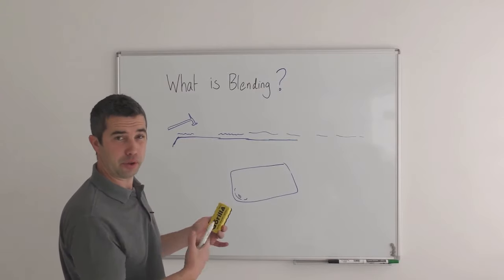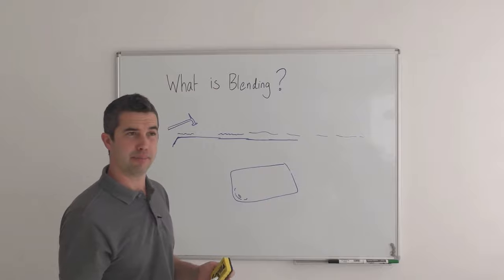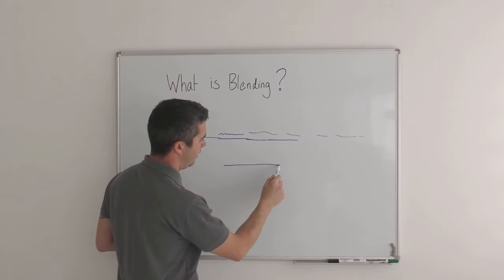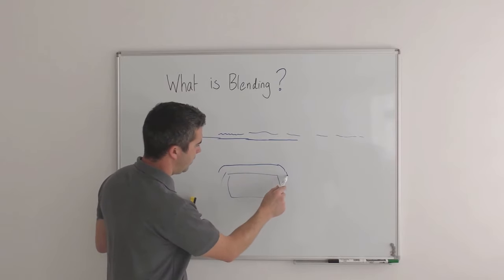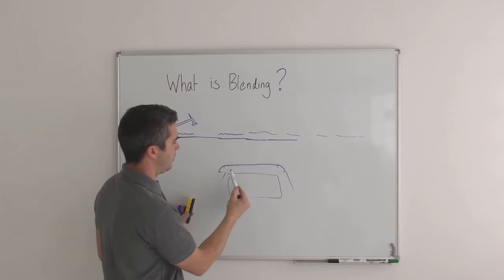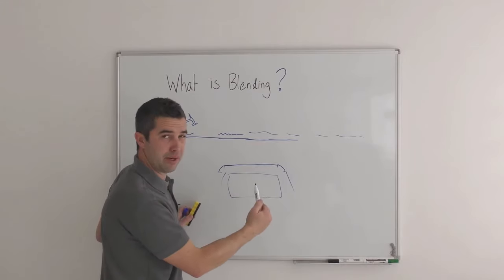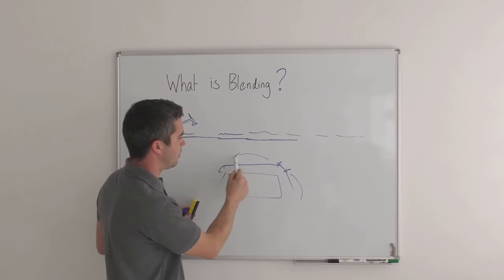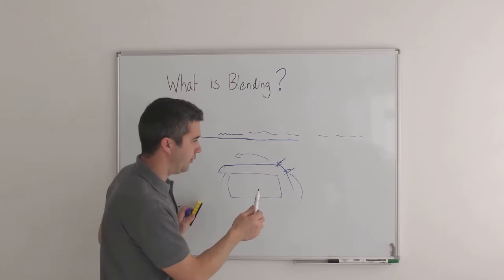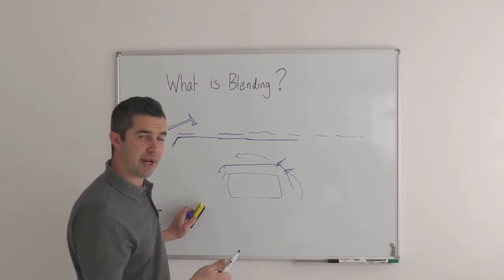It's definitely easier blending on the corner of a panel or where there's at least a ridge form giving it some kind of structure or shape. Often you'll see blending videos and probably the most common area it's used is on the roof rails of a car. Looking front-on at a car you've got your roof, your windscreen and pillars coming down. If this is your main roof panel you've just got rails - roof rails - down the side, and because they're curved already and under such tension and form, you can really send those waveforms down the panel and restrict it to just these areas, not sending vibrations all across the roof but focusing it on that roof rail traveling down the rail. It's very effective on areas where you've got a curve in a panel or you're at the edge of a panel where there's some structure, like a roof rail.